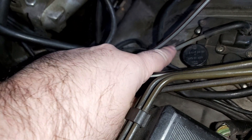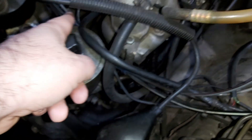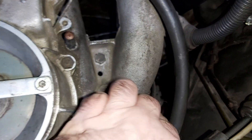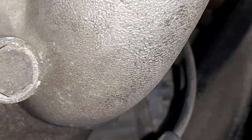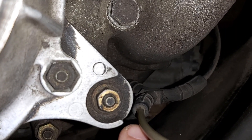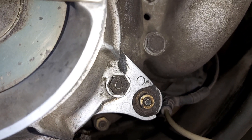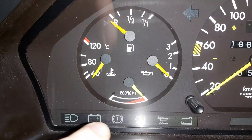Let's go to the garage. Concerning the vacuum tube from the EZL, here is the tube — I'm showing you this on the example of the M102 engine. It goes here, here, and then all the way under the intake manifold. It ends here — that's the one. It goes there — the T or Y rubber element. That's the one we need for the vacuum, and this is the second one we need for the economy gauge.